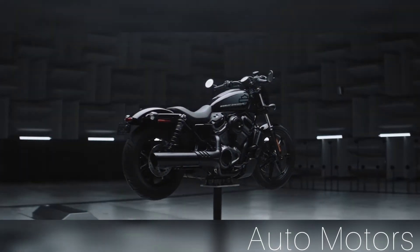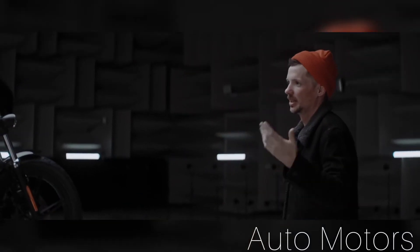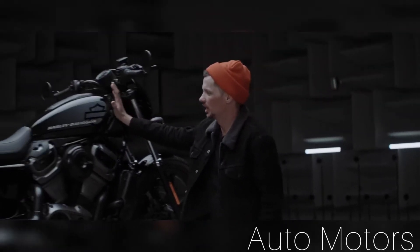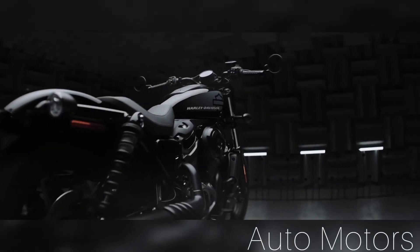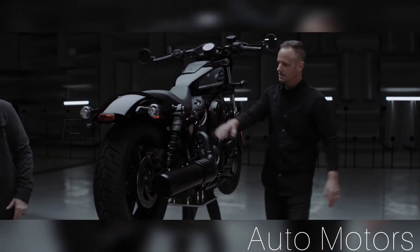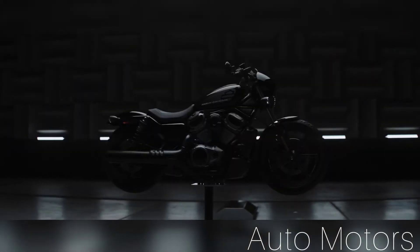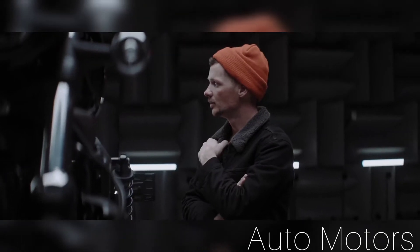In the end, the dual outboard shocks and the architecture of the motorcycle allowed a really radical solution: to put the fuel underneath the seat. That frees up the area that would traditionally be the fuel tank up here to become only air box, and it allowed us to get this into the size of the old Sportster fuel tank. Moving the fuel tank underneath the seat keeps the center of gravity of the bike low, which actually helps make this bike feel even lighter and more maneuverable. We've also increased the lean angle by three to five degrees on each side compared to Sportsters of today.